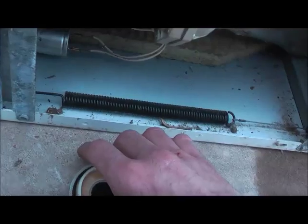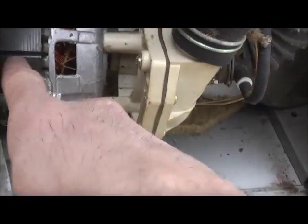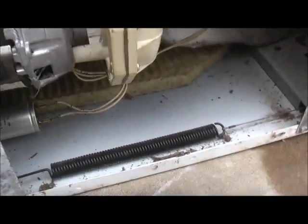Remember my containers at my dad's cousin's place? I decided to gut those out and get all the motors out of the dishwashers in those skips as well. Although the motors are not like this one — different size shafts, the old design's different and everything. So I'm stuck with this one and the bearing, but I can at least replace this seal on this pump. That whole seal should press out and fit into that one. It looks the same, so hopefully that'll fit.